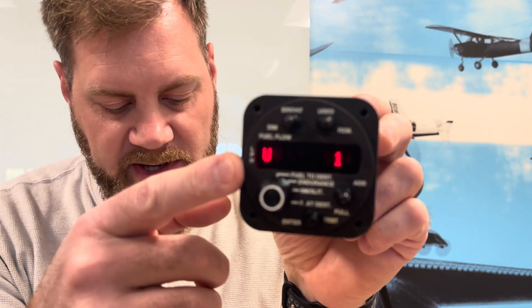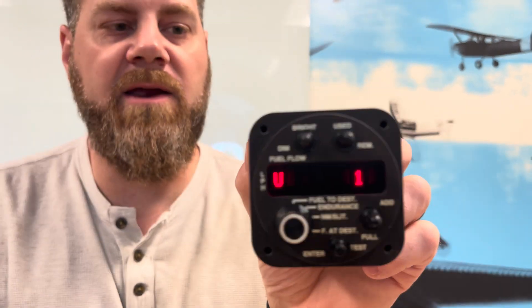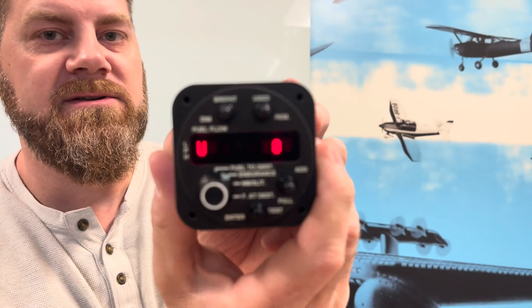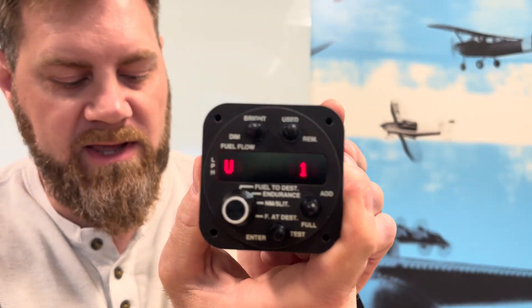Continuing: U=2 is pounds at 5.8 lbs/gal, U=3 is 6.7 lbs/gal, U=4 is kilograms, U=5 is 6.5 lbs/gal, and U=6 is 6.35 lbs/gal. Because this is a liters indication, U will be set to 1. If you had a 912-041T-38-D gallons indicator, U would be set to zero. You can adjust it with the Full switch, but we want that set to 1 for this liters indication, so we're going to keep cruising by.